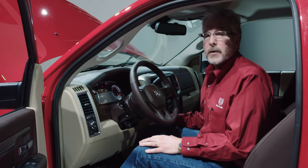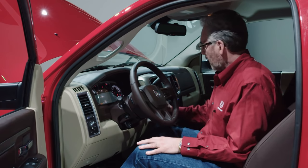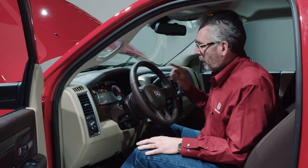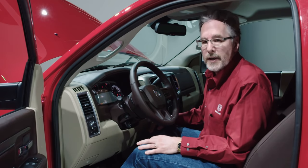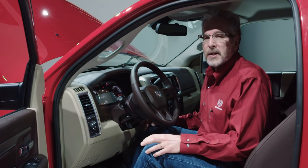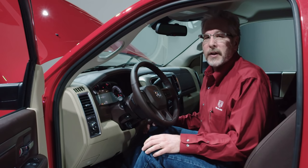The first thing I usually do is a quick vehicle self-test. I start the engine, come over, and press the PTO button. The RPM should ramp up to 900. The PTO light will flash — 8 seconds on the gas and 30 seconds on the diesel — at which point PTO will drop out and the vehicle will return to idle.